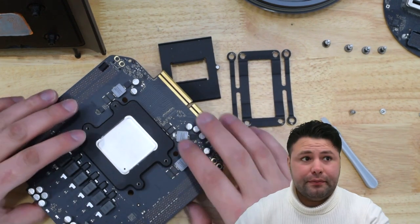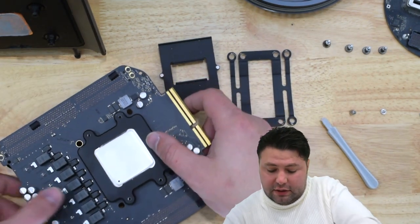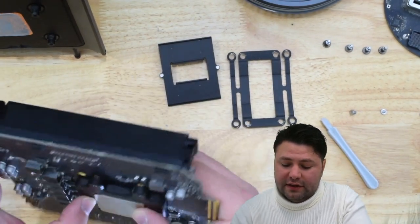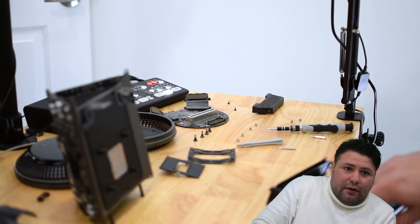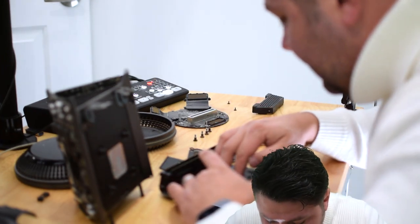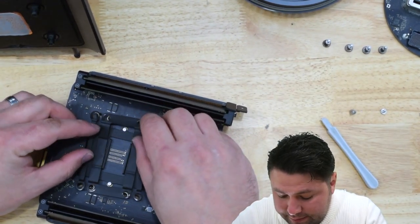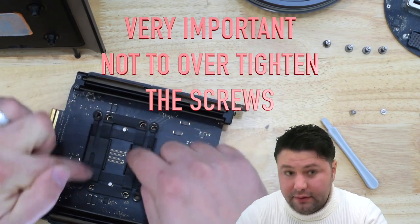Just make sure it's lined up. Now this is the most important part — we want to flip this over without the processor moving or shifting around. Once it's made contact, you don't want it bouncing around and bending the teeth. Slide it onto the table flat so it never moves. It's exactly where it needs to be, and we're almost done reassembling. Put it down and tighten up where the processor sits with these four screws first.